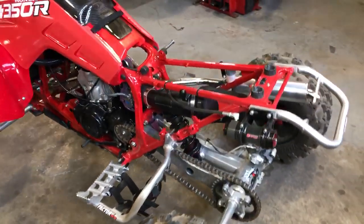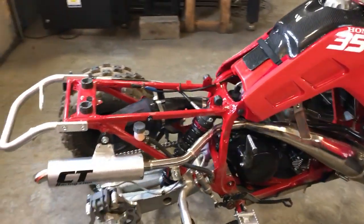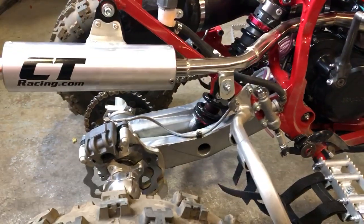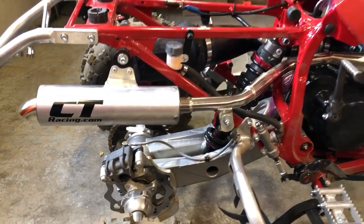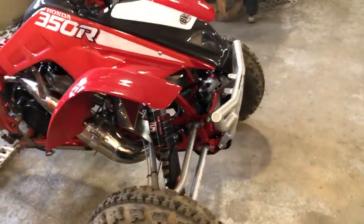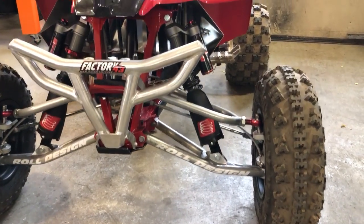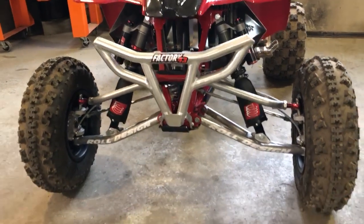So he chose to run Elka suspension, roll design, A-arm, and swing arm components. We feel it was a pretty good upgrade to go to the no-link rear. Completely changes the feel of this machine. The front end is actually considered long travel. Huge upgrade over the stock A-arms. It's hard to even consider this a 1988. I mean, it's really just the frame.